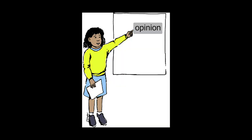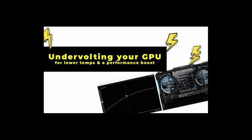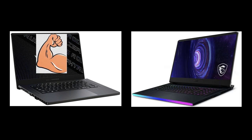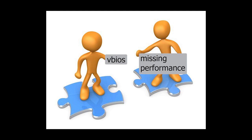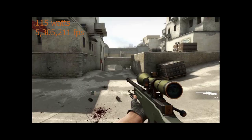My personal opinion — while I do find it kind of cool to be able to get an extra five or six FPS on some games with the VBIOS mods, for me it's not really worth it. I'd rather just undervolt my GPU, get lower temps, and get similar performance, if not just a little bit less. But for those of you who really want to match your friend's 150 watt or 140 watt 3070, then sure, this is how you can do it and enjoy your boost in frames. I think it could actually be helpful for those of you who are stuck — maybe your GPU is stuck at 80 watts for some reason and it just really doesn't want to boost up to a hundred. Then this could actually be good for you — load a 110 or 115 watt VBIOS, see what happens, see if it helps your performance.